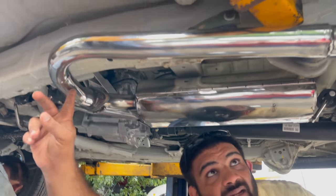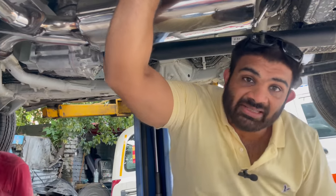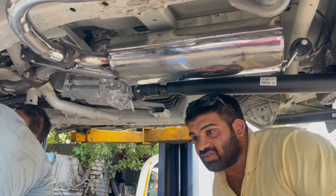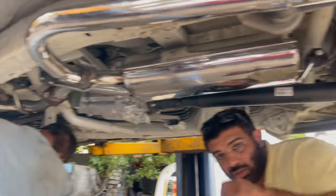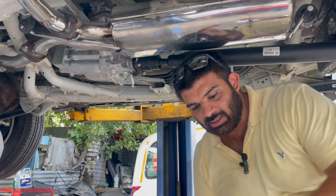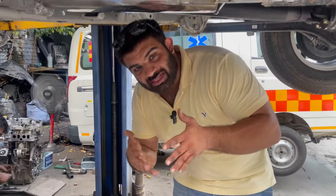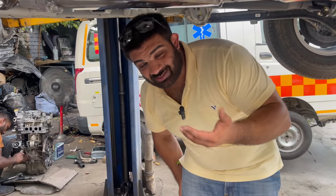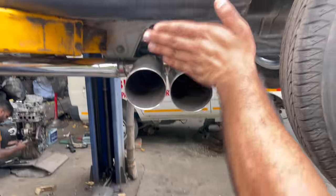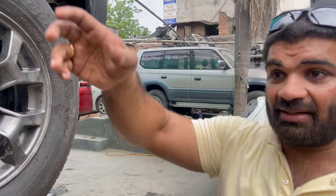It's going in there and coming out of the side. The fitting is pretty similar to what we had on the Nissan Patrol — that also has a side exhaust. This is a complete SS — complete stainless steel set — no issues of rusting and this is going to outlive the vehicle technically. Once they're done installing, we'll brief you through the entire set and show you the beautiful 4-2-1 configuration. That's the difference from a 4-into-1 — this one is 4-into-2 and then into a single pipe. The four headers merge into two, and those two merge into one collector, which gets you better performance as well.